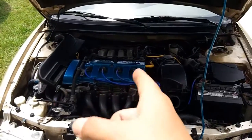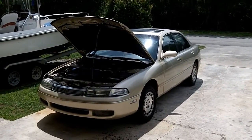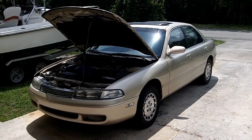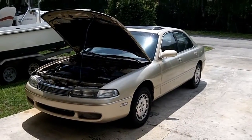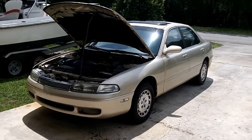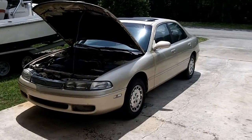I just got back from my test drive and my idle was so much better. My original MAF sensor was way better than that junkyard sensor I picked up — a huge difference — and I didn't do anything else other than swap out the MAF sensor. If you have a high idle fluctuation condition, I would recommend looking at your MAF sensor. Clean your MAF sensor — I have a video on how to clean your MAF sensor. And now you have a video on how to test it as well. I didn't actually test the old MAF — I'm just going on my drivability issues.